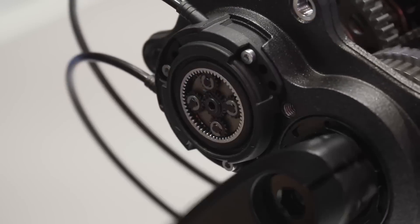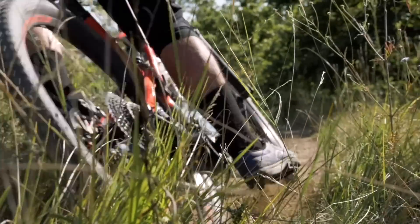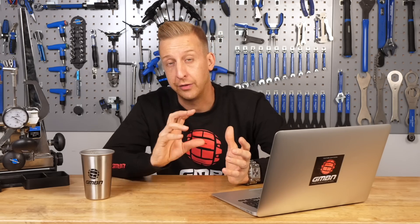For normal mountain bikes, the cassette system is far better — there's less friction in it. Moving that weight from the back of the wheel is something we still need to figure out. You're starting to see this with the pinion gearbox system, and even with e-bikes, things will change in the future. If you were going to have a one-by system and use the freewheel on the front, you'd need a pretty big chainring, putting a lot of stress on a system that's already not the most reliable. The cassette system on the back has been refined — there are ratchet systems on hubs, they're very reliable. I'd rather pedal something that is reliable and won't slip or endanger me when I'm riding.